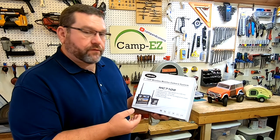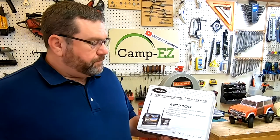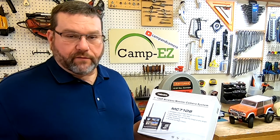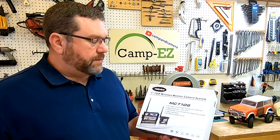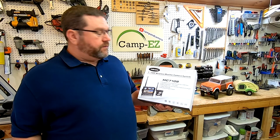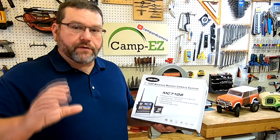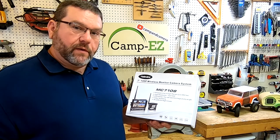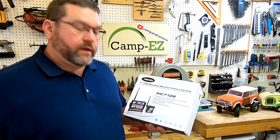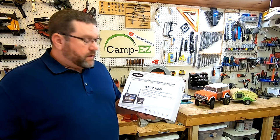So just a few things that Halo View mentions on the front of their box. First, it says it has a wireless sight range of 984 feet. Now I'm a ham radio operator and I know a little bit about radio wave propagation. Usually line of sight means unobstructed, so I imagine on the back of a camper trailer I'll probably have to stick the antenna above the roof line to get the best reception. It says it has 720p definition, which technically is high definition. It has an IPS panel, which means you don't have to be looking straight at the monitor to see it well — you can see it from the side too. It also says it does video recording, so hopefully we can record some video for this YouTube video. And it says it has IR LEDs for night vision.